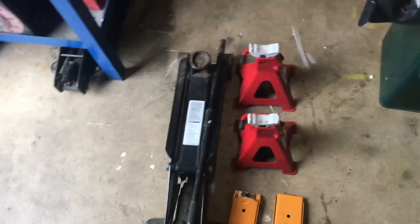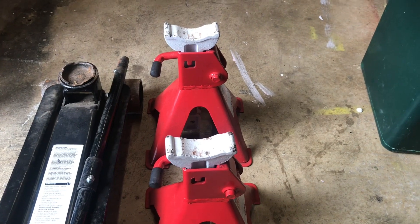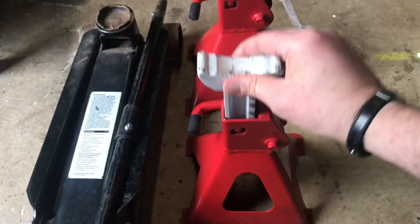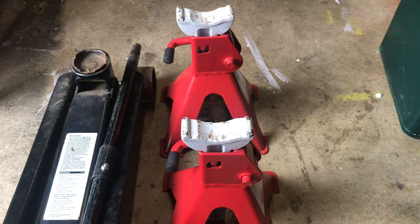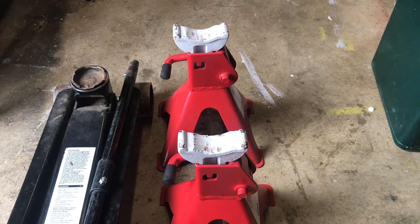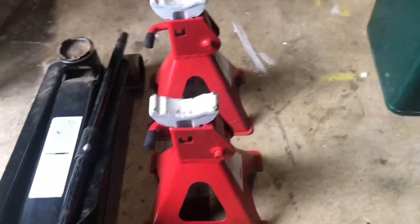The car could end up falling on top of you. You need axle stands — I got these from Sealey, they're reputable and I've used them quite a bit. I'll put links in the description. These are the ratchet type with easy release. Always use them, and find the proper safety points on your car so they're not just going to pop through the floor. Don't put them under gearboxes — find the proper jack points.